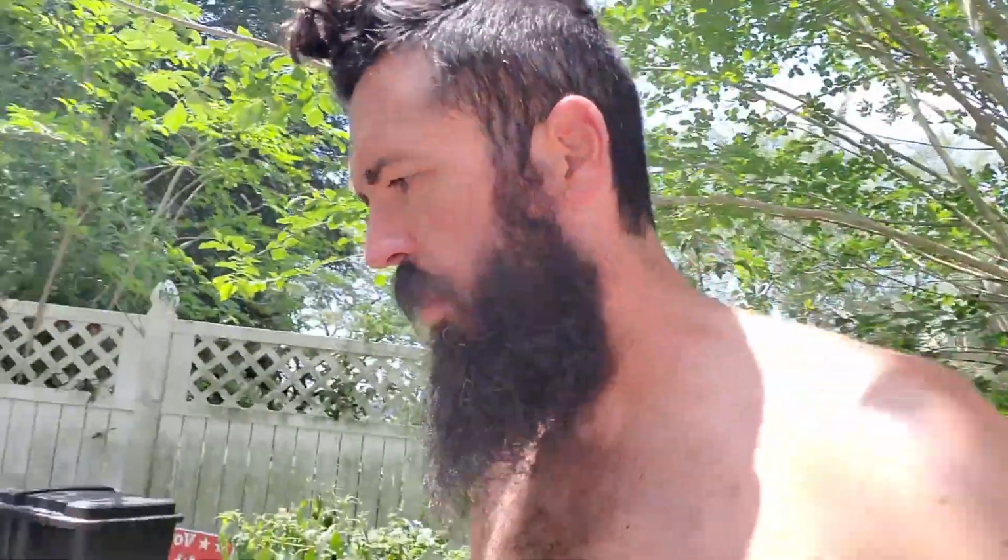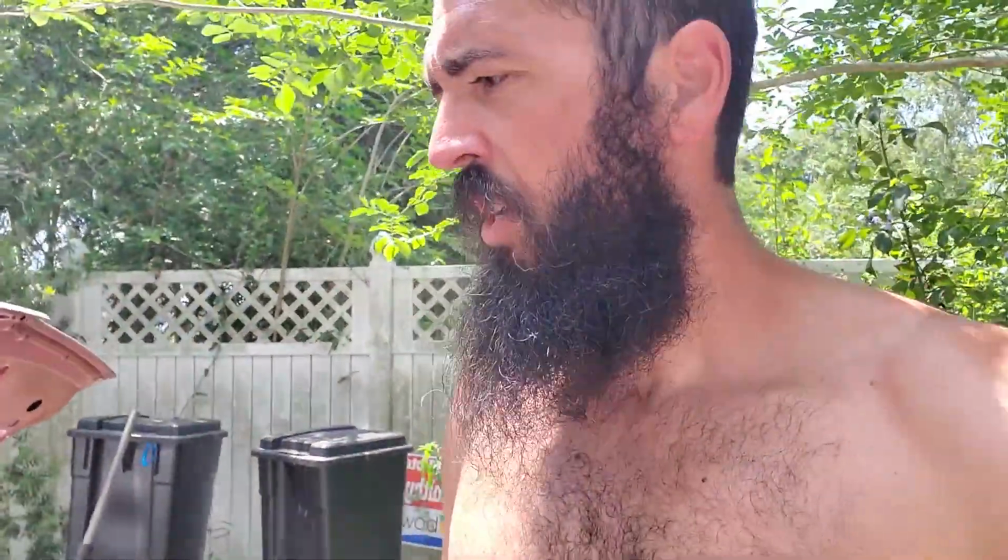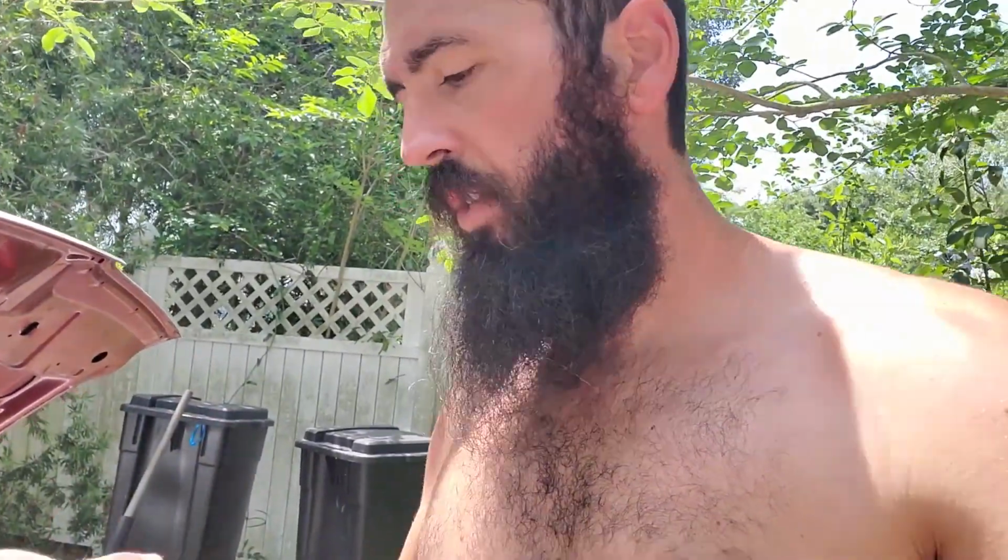A couple years ago at Auburndale Speedway, mid-drift, when you flick it in and the wheel starts to counter-steer, it caught my pinky and broke my pinky because the steering was so heavy. But I think that might be alleviated a little by a tension steering adjustment on the rack itself. Might also look at depowering it, or converting it just to a manual rack, but that's for another day.